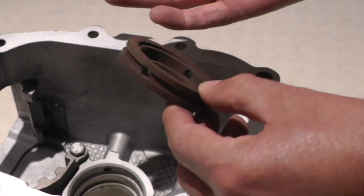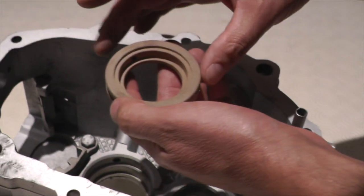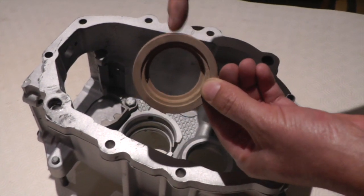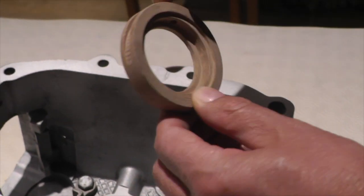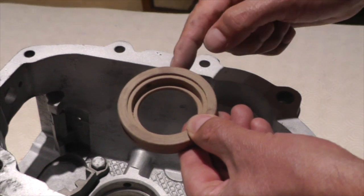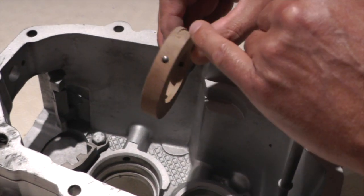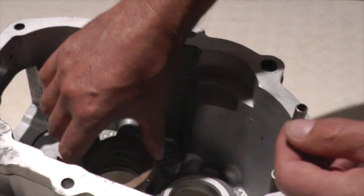In my opinion, a complete design flaw. The part that we make is similar — it's got the pin at the bottom which drops in the groove at six o'clock. The oil comes in the side here; as you can see it's got an off-center groove machined, so the oil comes in at about two o'clock. It then pressurizes this groove and feeds through these holes to the center diameter, but because it's off-center it can't leak around to the bottom port, because that's blanked off.